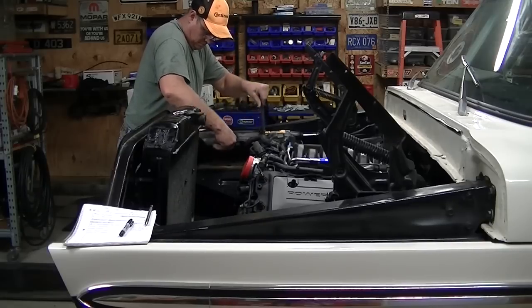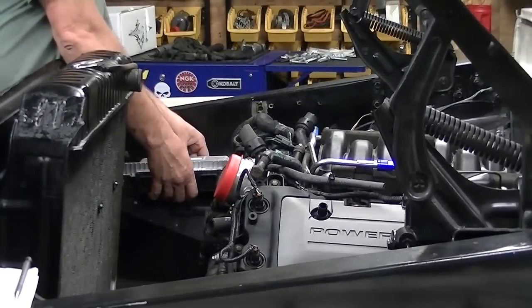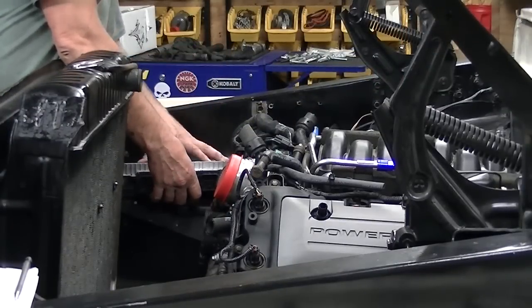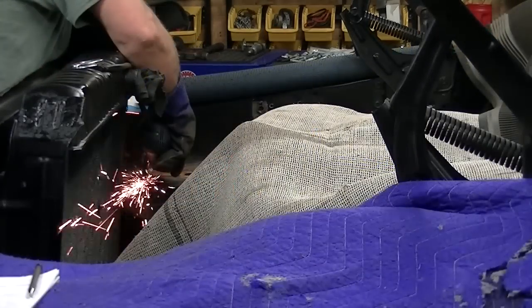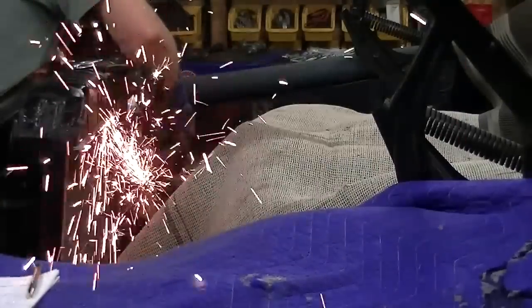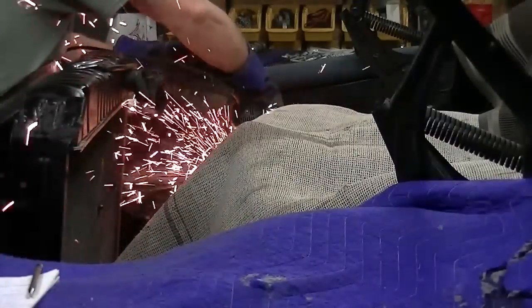What I like to do with the ECU is pull the battery tray and test fit it to see where it's going to go. Then I cut a chunk out and basically make a little hidden compartment. I slide it in, it stays cool, I seal it, it's dry. It has a cover on top so you can still get to it after you're done.